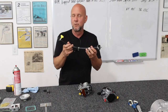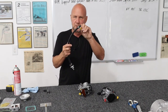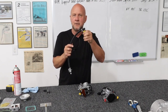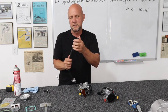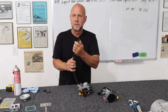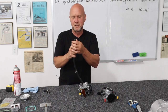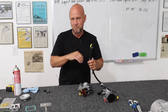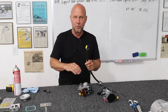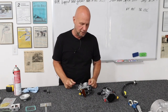How do you take this part without it leaking? This is only designed for the newer bikes with the pump on top of the tank. You just use this clamp-on filter and pull it away from the tank. Yes, it has fuel in it and it could spill. If you don't want it to spill, you could slide a spark plug or a bolt in it. I usually just leave it, keep it out of the way, and take the tank off — it's fine. Make sure there's no sparks, because the battery's right there. No fuel really spills out, and you are fine.